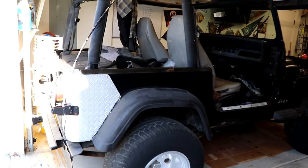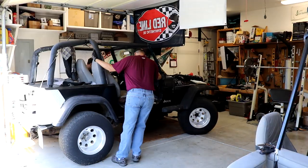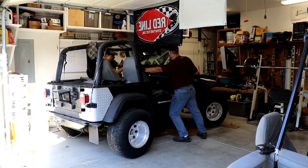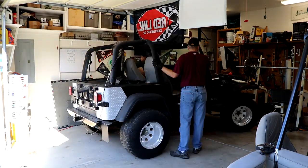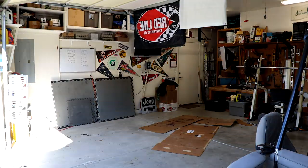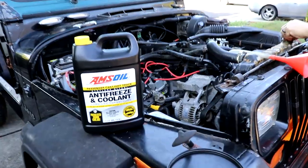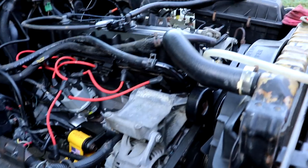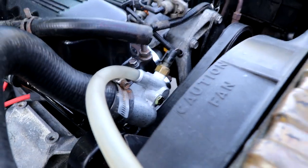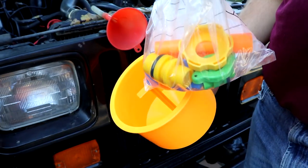So the very first thing — I've got this Jeep wedged back in the corner of my shop, so I've got to get it out of there. First thing we are going to do is fill it with coolant. I'm actually going to run some down this funnel right into the thermostat housing to try to get some in the engine that way, and also fill the radiator completely full. Then we have the burping mechanism we're going to use.